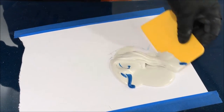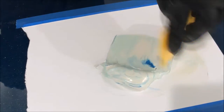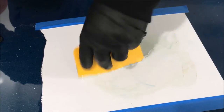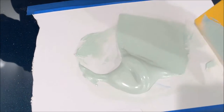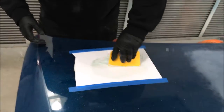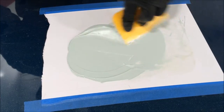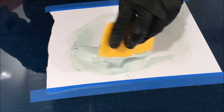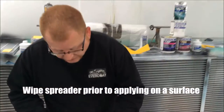This product is a little bit looser — mixing it is more like mixing a cream. You won't find these products in a hobby center or typical retail store; this is professional grade. Using that squeezing motion, expelling and squeezing the air out as we mix — it's the little things like this that make the difference. Taking a little bit of time over your mixing, thinking about what you're doing, removing the air, minimising the chance of pinholing. We've not come across any pinholes yet.